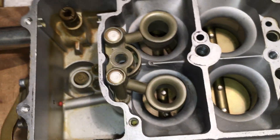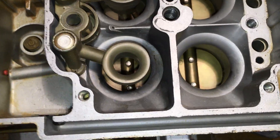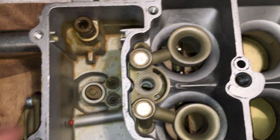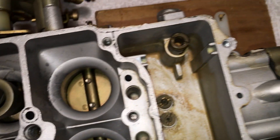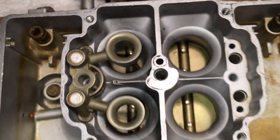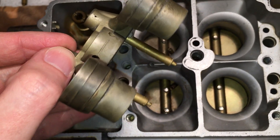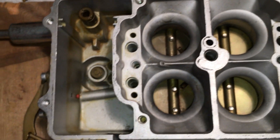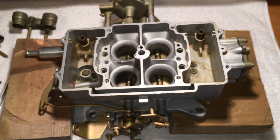That's all the holes, unless any were missed. The rest either don't do anything or are just for mounting — the center hole doesn't do anything, and these are all closed mounting holes for screws. So that's all the holes you need to worry about if you're rebuilding this. Especially on these emulsion tubes, don't forget about those top, front, and back holes. So there you have it — the Autolite 4100 and all the holes.